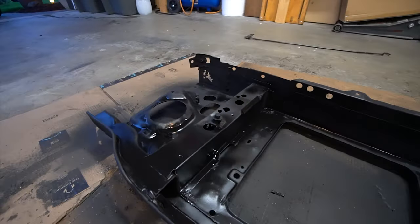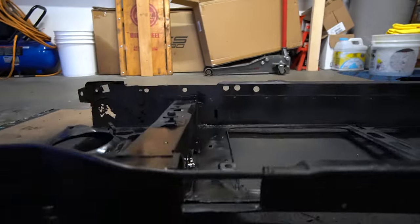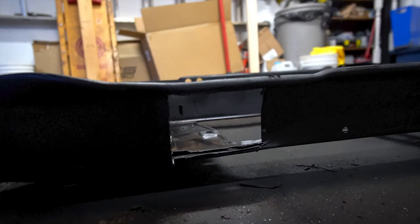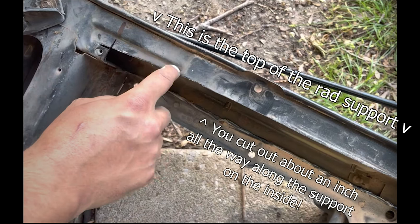I just wanted to do a little voiceover here about the trimming we have to do for the radiator. This section right here is the hole I cut out to be able to get access to the radiator fill cap on the top. Right underneath that hole, there's an entire tray or section on top of the radiator that we need to trim out — about an inch of it. I didn't film myself trimming that, but I followed another guy on YouTube — his name's The Gladi Daddy — he did this very recently using the exact same radiator. I'll put a link on screen and in the description. It's about 50 seconds and he shows exactly what needs to be trimmed.